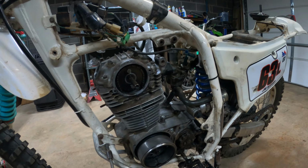Probably not. But when we look at this piston more, the rings were getting caught on that ridge and the ring actually broke off in my hand. So she's no good. Now, before you install your piston, I like to install a wrist pin. Not a wrist pin, the C-clip. That way I don't have to fight two of them while it's on the motor. And you already know you're going to drop it, so... I don't know why they don't give you three of them. You always shoot one in outer space.